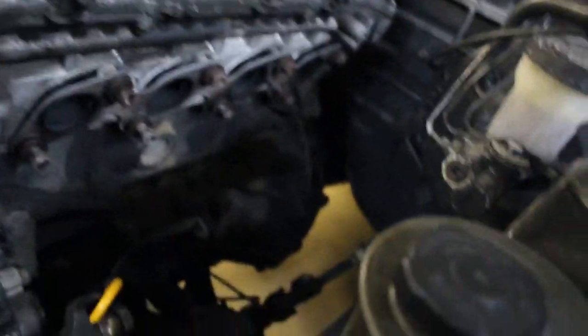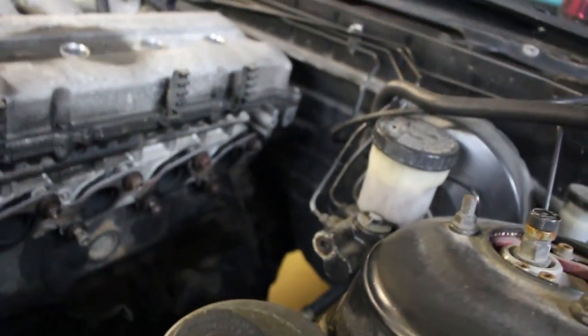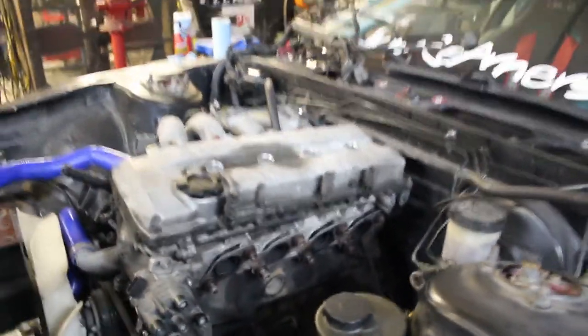I'm going to go ahead and wrap up the night. I did not actually get the motor pulled. I started on the exhaust — I had the lower portion done earlier but the upper portion, the actual header down to the downpipe, was really hard. One bolt was broken and two were really rusted, so I worked on getting that cleaned up and got the header off. It was a Megan header, which will obviously be replaced with the turbo manifold.